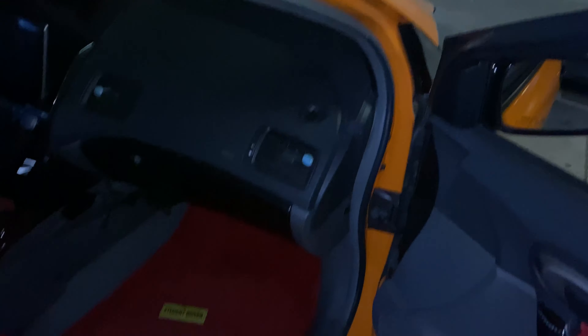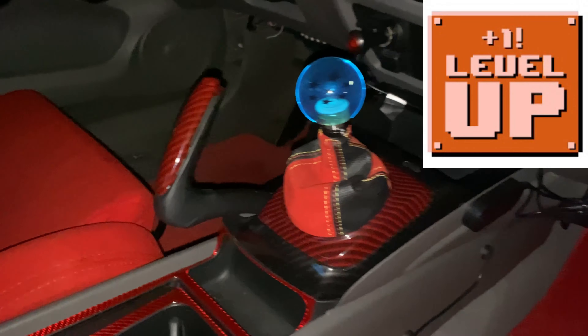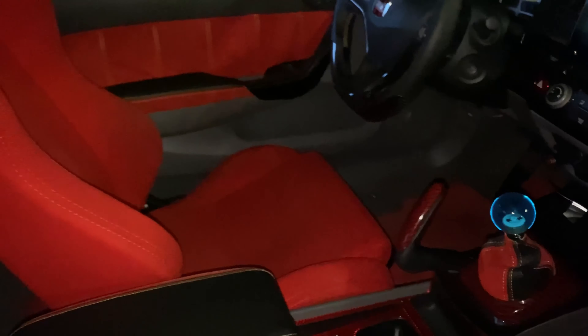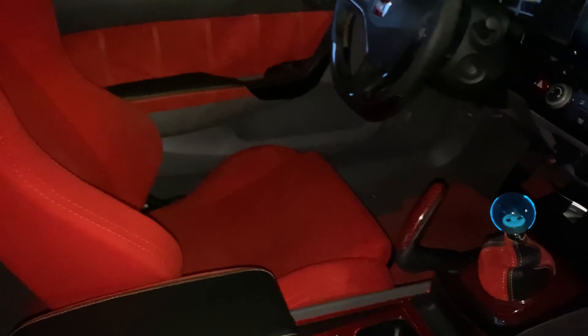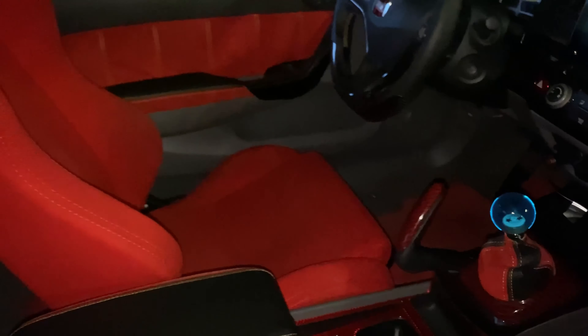Carbon fiber switches — let's throw them back in the car. Almost done. Here's the reference — those are the old black ones. One more thing I mentioned earlier: the pin you need for the e-brake. Since I've got the extra pieces, I can show you the hook I was talking about. That's the hook at the end of the e-brake handle — the ball has to go into that hook. If the ball doesn't go into this hook, whenever you push the button it won't snap back. It'll just go up and down without any pressure. Make sure the little ball goes in between that hook.